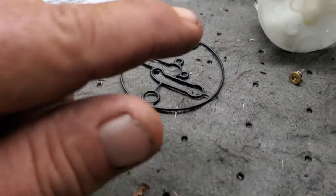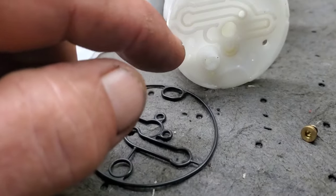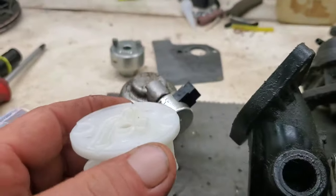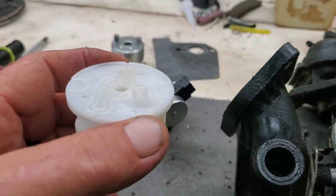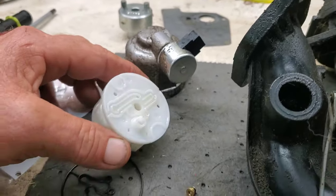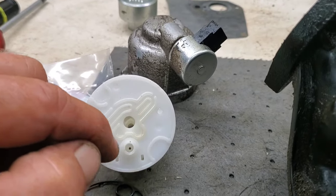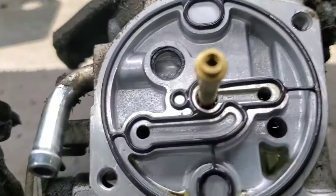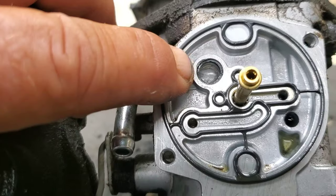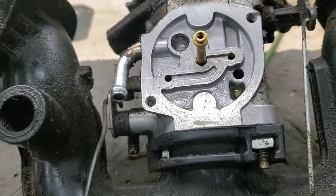What I like to do is put the o-ring on this piece and put the gasket on this piece, then hold it upright and turn the unit of the carburetor over top of it and slide it down on. After you get the o-ring laid up and pushed on, I keep a little thing of Vaseline on the carburetor bench and I'll put a little Vaseline around there. The reason why is so that it'll slide back in easily without cutting it — because what you don't want to do is cut the new one.